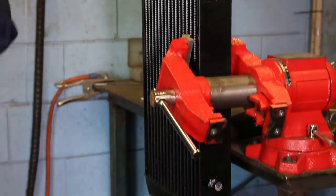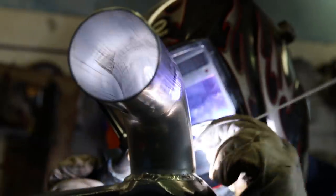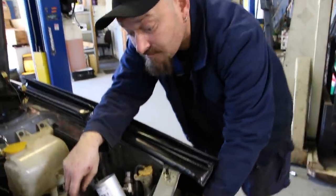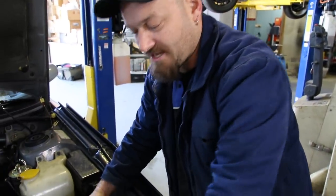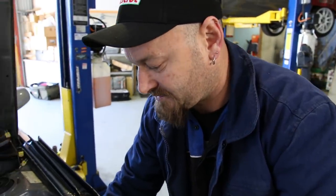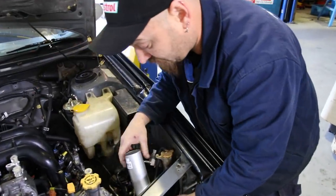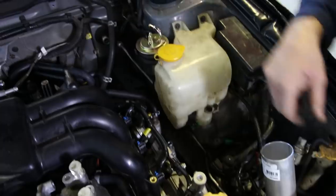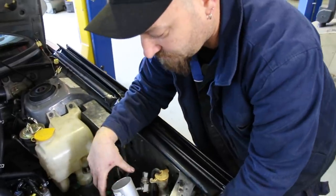The alloy pipes are then AC TIG welded to the right shape. This is to prevent having to use lots of silicone - it's more to keep the silicone away from the front where you can't get at it. You've got to take the headlights out to get at it if you want to take the pipes off, which is pretty annoying. So just make it solid through to around about here and then run it on. We'll just have one silicone joiner here, and one there - only two in the whole engine bay for that side. Take the pipe off if you want to get at anything or clean the throttle body.